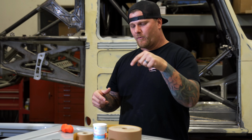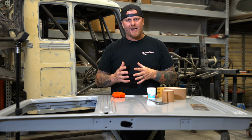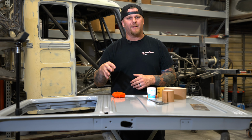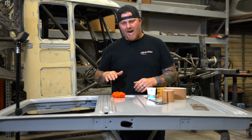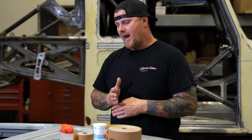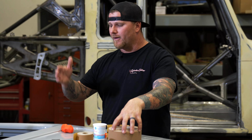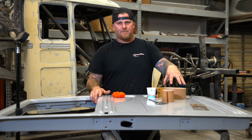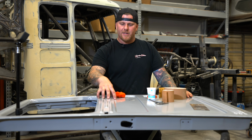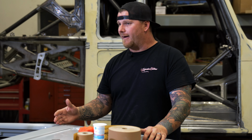But more in depth, when it comes to the sandpaper thickness, I'm going to be spreading this, and because I want to catch the details and I don't want to use 80 grit to rough it in, I've got to let that dry pretty much to the point where it's completely cured and then sand it. So I'm going to start at 120 grit, and my goal is to finish out with 150 grit because that's what we like to prime over for our final primer. The thickness being 20 thousandths on 150 grit, my thought was, let's use some vinyl plotter paper. We use vinyl plotter paper for doing all of our graphics and cutting.